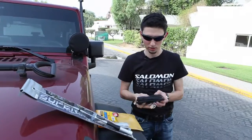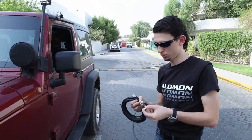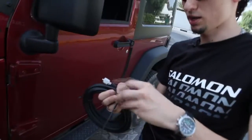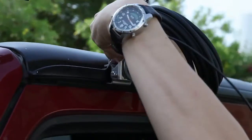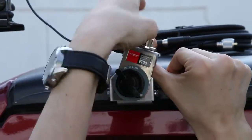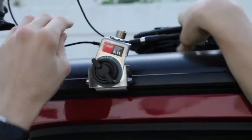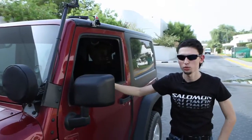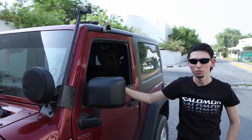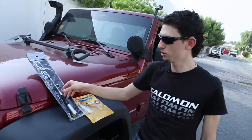The next step is installing your through-hole mount. Put the cable onto the gutter mount, remove the shielding cap — try not to lose it. Nice and careful, then you just get it through the hole in the mount. Keep holding it from below and secure it nicely. You can tighten it later. Technically, when it's a permanent installation, the cable has to be run through your firewall or whatever suitable place in your car, just not to damage it.